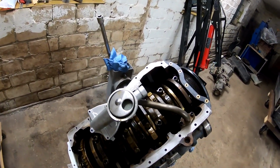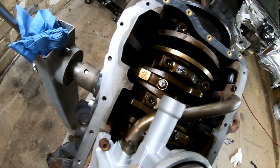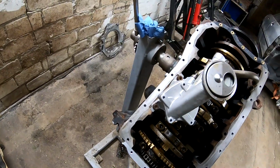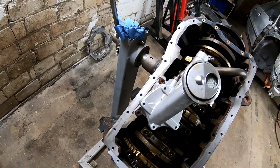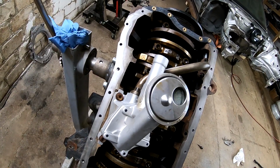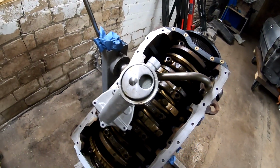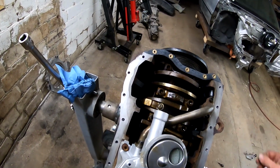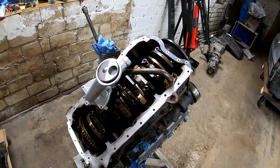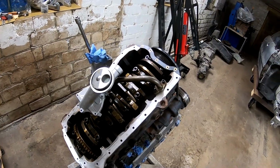The pump is changed. Nothing tricky. I need to open these two bolts and these two tube ones, and then you can take the oil pump out. Here is one shaft that turns the oil pump. You need to fit the hex so that it fits directly, and then it's all good. So, really easy work. And I also cleaned the oil pan again, so it's ready for silicone. And then we can start working with this flywheel setup and clutch system install.